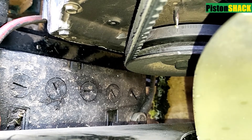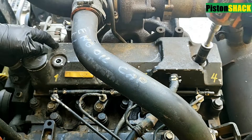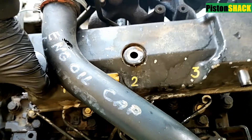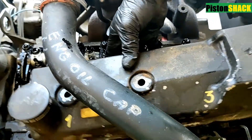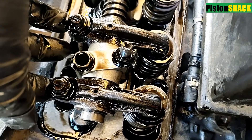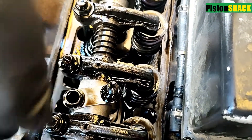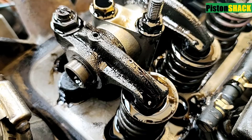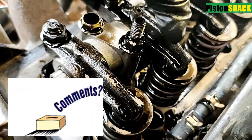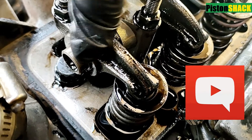If it's helpful, thumbs up. Let's take the valve cover off with a 17 mil socket and check it out. At our first cylinder, both valves should be closed at top dead center compression stroke. And yeah, that's simple enough. If you have any questions, comments, or critics, put them down in the comment section below. See you next time, bye bye.